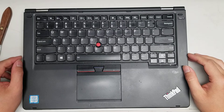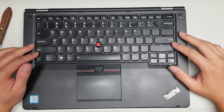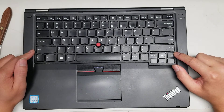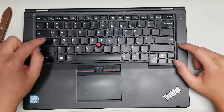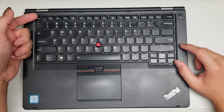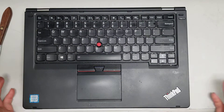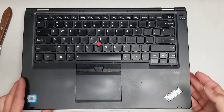If you're curious, the best way to find out how this keyboard is holding itself in place is to go on eBay, Amazon, or wherever and search for the keyboard for this model, then look at a picture of the back. Usually from there you can tell if it has holes going through the keyboard. Most likely you're going to have to peel up the frame and then undo a bunch of screws underneath. But that's pretty much it for this video — hopefully it helped you. If it did, make sure to like and subscribe. Thank you for watching.